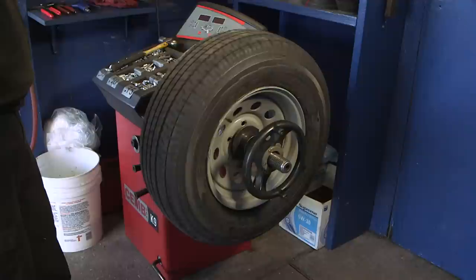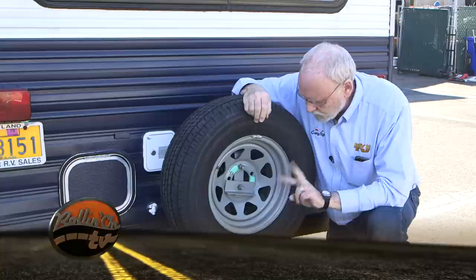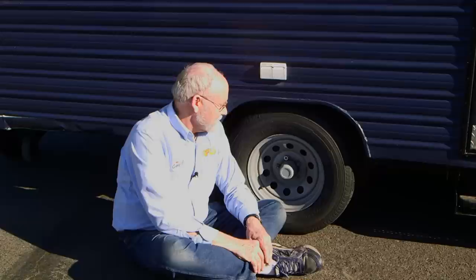One of our wheels had more lateral runout than it should, so it required more weight — in excess of six ounces — to help it run true. The other tire and wheel combo was fine and called for approximately two ounces to balance. When you get new tires for the trailer, for the ones that are on the ground, don't forget the spare. Because if you've got a bad tire on the spare and you get a flat, you're taking a risk. Add the extra tire to your purchase — you won't go wrong.